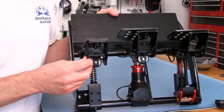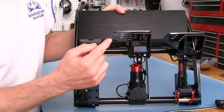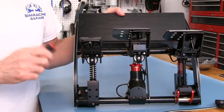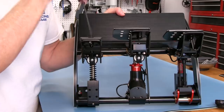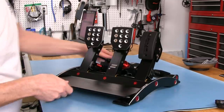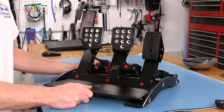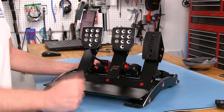I had to put the throttle bracket on the front pair of slots - the clutch and brake brackets are on the rear slots to get them as far forward as I could. There are half-inch centers on this bracket, so if I had this sticking out another half inch further with my foot all the way down on the brake, I'd have to reach too far around to get to the throttle face. I wanted to show you the different things that can come up when you're trying to get the configuration the way you want. Also, before you put the pedal faces on, go ahead and put your motor mounts back on first so you can reach through the bracket holes and tighten that screw. Then go ahead and put your faces on.